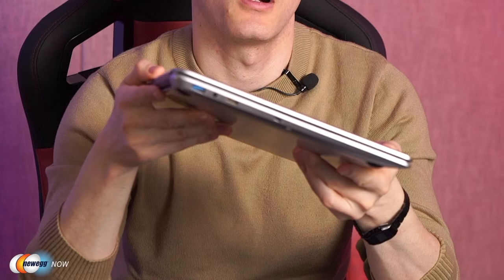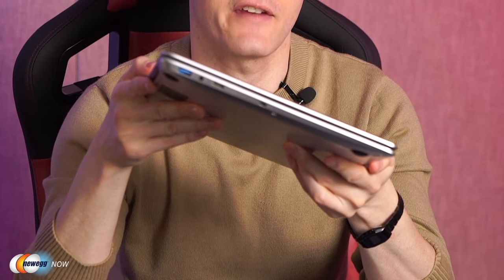It does excel as a school or office companion or a handy laptop for web browsing and watching videos around the home — if that's what you're looking for, it's a great option. It also comes loaded with 6GB of DDR3 RAM, which is plenty for routine apps, and a 256GB SATA SSD. That SSD is going to allow you to boot up faster and seamlessly run multiple applications simultaneously. Power-wise, we're looking at a 38-watt-hour lithium polymer battery, good for about eight hours on a full charge.